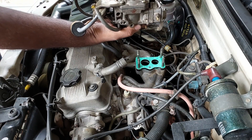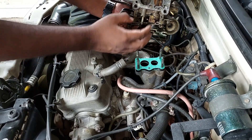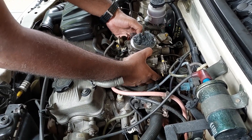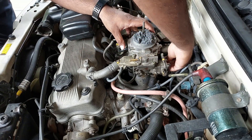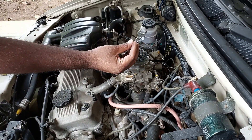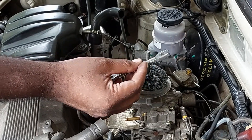Now let's install the carburetor. We have covered the carburetor inlet to prevent any entry of debris. Once again, check all linkages and make sure everything is functioning properly. Now let's install it onto the manifold. Let's install all four mounting nuts. Start with the rear nuts as you have to lift the carburetor to do so. The spanner we are using is a double-sided 12mm one, trimmed on the sides a little to reach tight places.